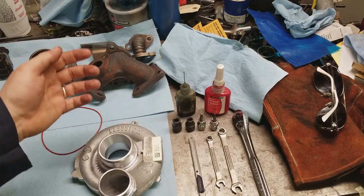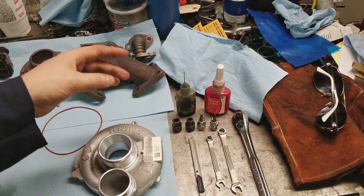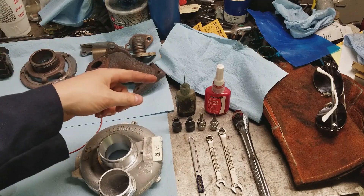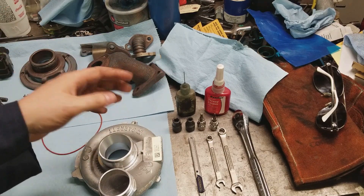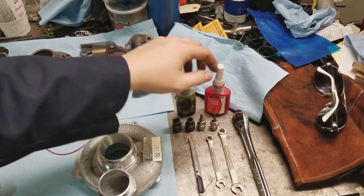This whole thing is already disassembled. I'm going to be explaining the whole process in the reassembly phase, but it's absolutely critical to use heat and penetrant to get this thing apart, or else it won't pop apart. For reassembly, I'm going to be using red threadlocker — red Loctite.